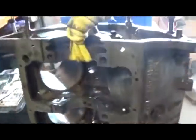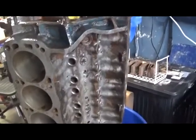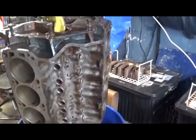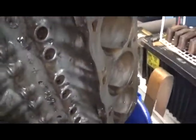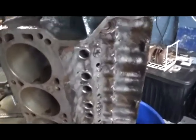It just keeps getting better, no surprises. We'll give it another quickie. We can't call this a success until it goes through Magna Flux — no cracks. But as far as cleaning this thing up from a big pile of rust that just needed to go to the junk yard — or like I like to say, put it in the front yard and tie a goat to it — to something that you can work with, it's remarkable. I can't say enough good things about this process of electrolysis, and using vinegar to do it. You're getting the double hammer — you're getting the benefit of the acid that will absolutely eat this rust off by itself.